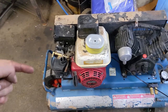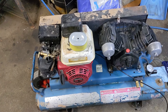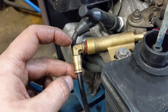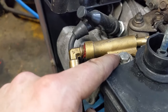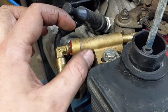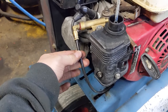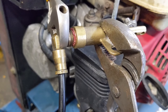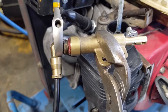Because this already ran and I know it just didn't throttle back up, I know the line is clean enough. But I like to come down to this fitting and remove it if it has a free-spinning nut — which this one doesn't. So to get this off, you have to unbolt the throttle control piston and then unthread the piston from the line. Then you can back-purge the line with your compressor. I use channel-lock pliers on the end and a small adjustable wrench to hold the fitting and spin off the throttle control piston.